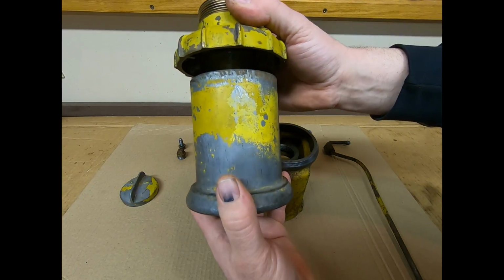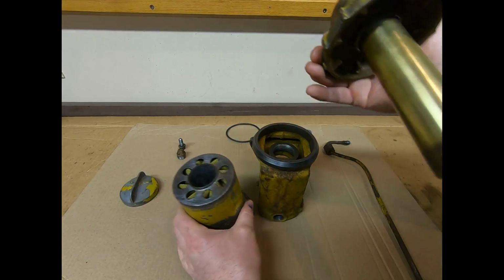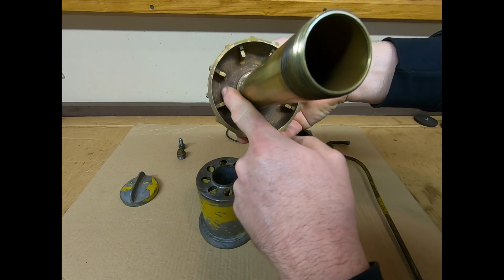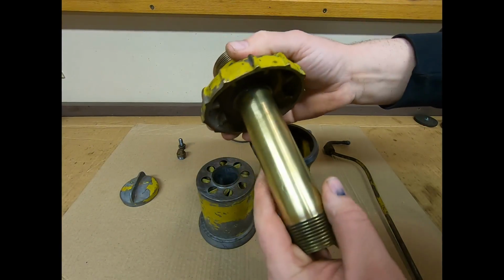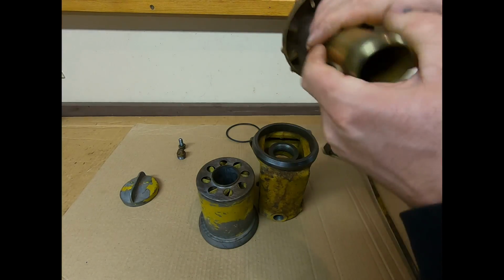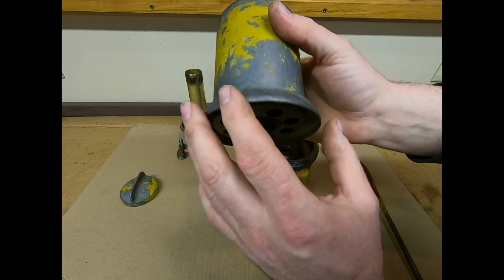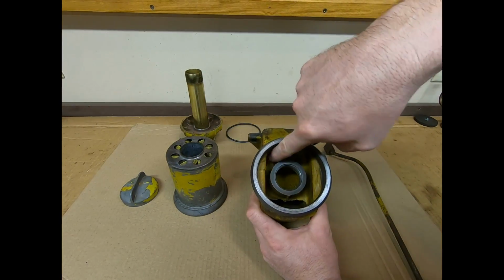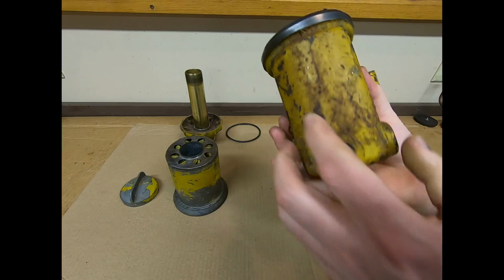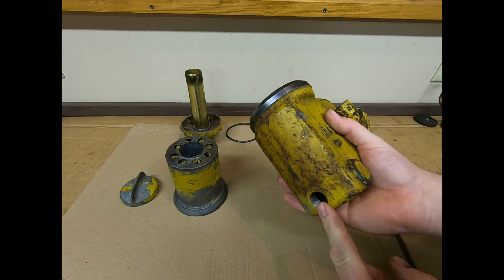Any lighter vapors are still going to continue to come up out the top of this breather can and basically come out around these fingers and just out from underneath this brass top piece and vent out to the atmosphere. But any of the liquids that form will run back down through this media, drip out the bottom, and enter into this area here and collect down in the lower reservoir where they can be periodically drained off.